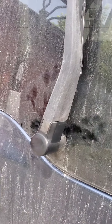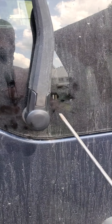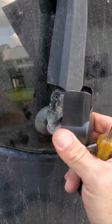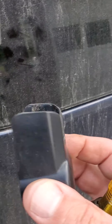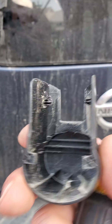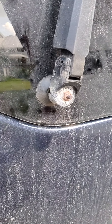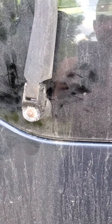This cap on the back — you're best to do this on a warm day, just because these can be very brittle if it's cold out. The easiest way to get them off is to get something skinny in there and pop it off. You can see those two tabs on the top go into these holes, and that's really all that holds it, other than the little tabs in the bottom. There's your nut — that doesn't look very good, so hopefully it's going to come off without snapping. I am going to lube that up first.